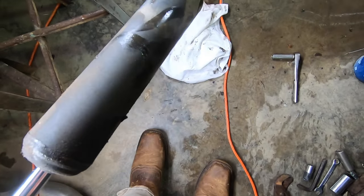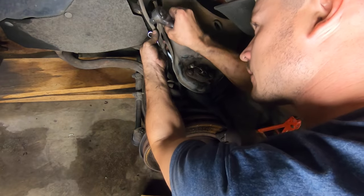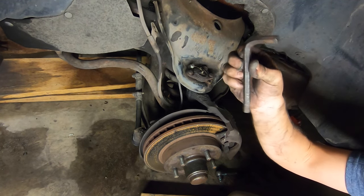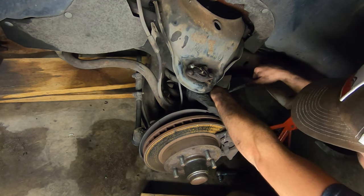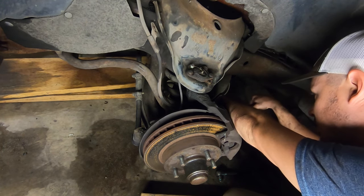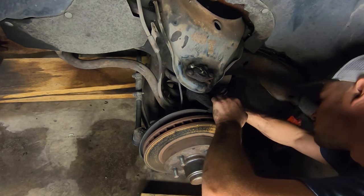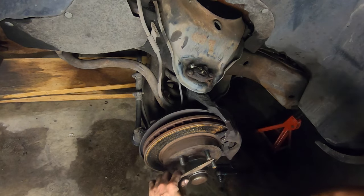These are probably the OEM originals from '99. To start, you gotta take this brake line off — it's annoying because it has bolts on the back that you gotta hold, 11mm or 7/16. To get the brakes off, use this as a little cheater to break it loose — one down below. They've got a little rubber cushion around them, so if you've never done this it'll seem like you're not at the right spot, but that is the right spot. Once you get them broken loose and those bolts are broken away, take this off.